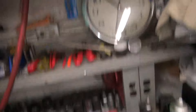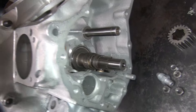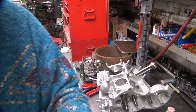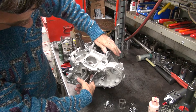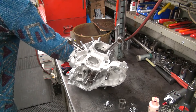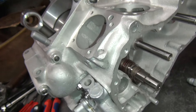I'm not doing that today though — it's getting late, it's been a long day. So that is all on there right now. Obviously it turns nice and free. So what you want to do is put some lubricant on those gear teeth, because they are not going to get any oil on them until the whole motor is lubricated and it's returning oil. So we want to make sure we have some lube on those teeth before that. So we just take that and rub them on the teeth a little bit and rotate them, and that will lubricate the whole thing. See how the gear is lubricated — now it's going to lubricate the one down there too. See the oil down there now. That works good.